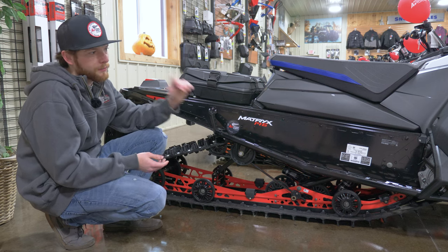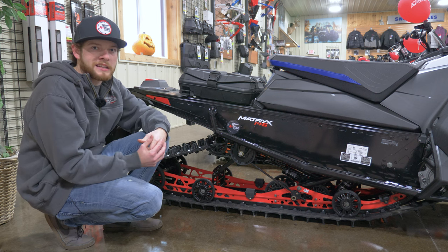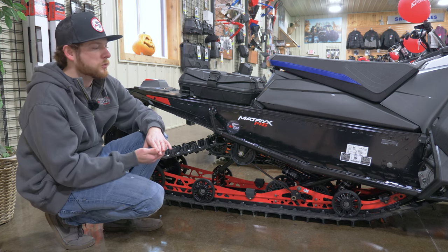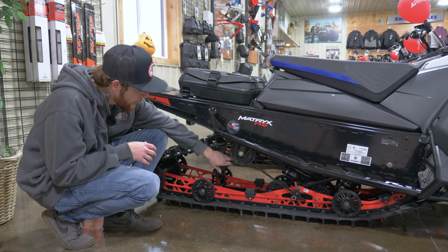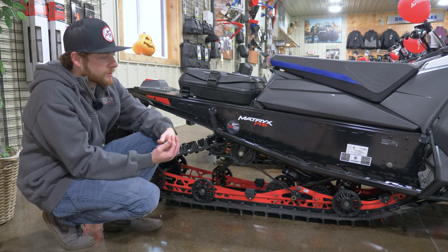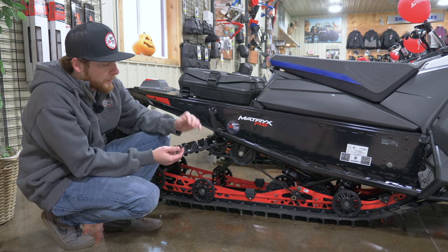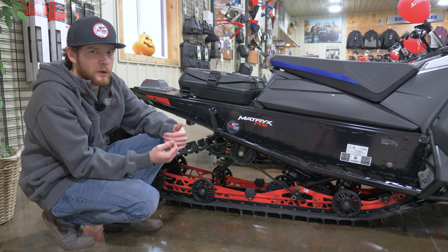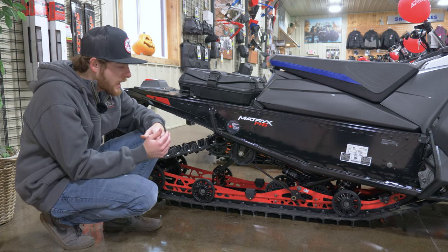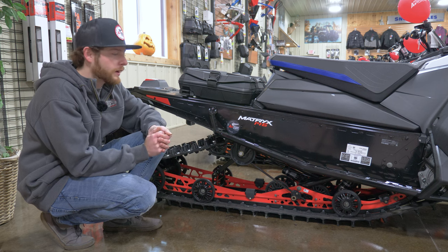Setting up my rear suspension, just like the front shocks, I'm leaving everything stock for the first couple tanks of fuel. I really want the seals and fluid working through the suspension before I start fine-tuning. When it is time to adjust, I'll do a lot with the rear torsion spring — it's on the middle setting right now, and you can go to low or high to fine-tune ride and comfort. Our front track shock is still on three clicks, just like the Fox QS3 up front — that's going to tune the pitch of the sled. I highly recommend playing with the clickers once you're comfortable. You really can't hurt them. I don't suggest touching your spring rate or preload — just leave those at factory and see what you can get out of the clicker adjustments.